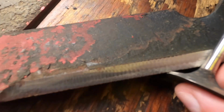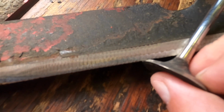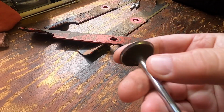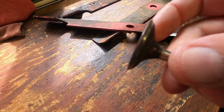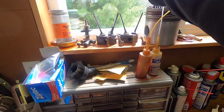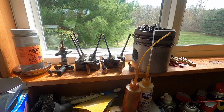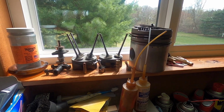You can kind of... It's definitely dished. But that's what real heavy, high RPM engines with heavy valve springs do. That engine will rev, the redline on that engine is 11,500 RPM. Yeah, I think the dishing shows up. That's about 7,000 miles. And those are both from my KTM 450. So you've done it twice? Yeah, 3 times.